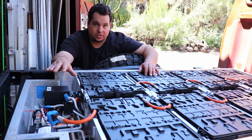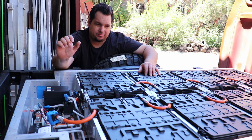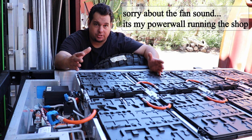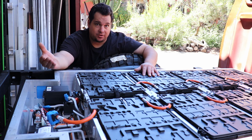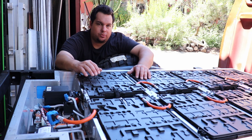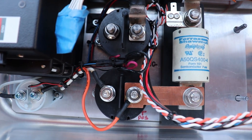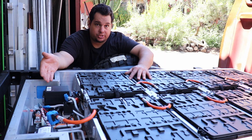There are a couple things I did change on it. I changed the contactors and the whole contactor box area, mainly because the contactors in this thing are rated to do 400 amps for the i3 motor. But since this motor takes 700 amps, I wasn't feeling too confident leaving those stock contactors in there. So I switched them out with bigger ones that can take up to 1,000 amps.